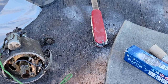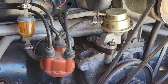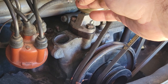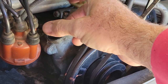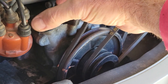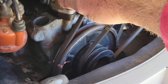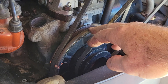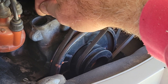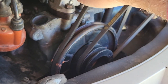Let's talk about installing it and a couple of problems you might have. I was on the phone with CB Performance and asked them about this. They said it depends on the fuel pump you have as to whether it fits. They said usually it will fit on all of them, but sometimes it conflicts with the lines. You might have an issue where you have to clock the distributor — pull out your drive and set it in a different position. To do that, set it at top dead center on number one first, then remove the drive. Be very careful — there's a washer on the end down there that could fall into the oil.